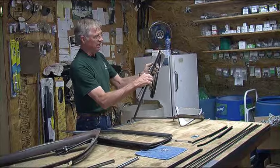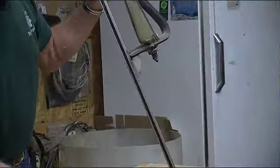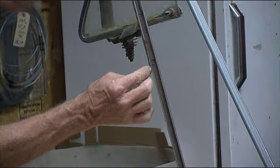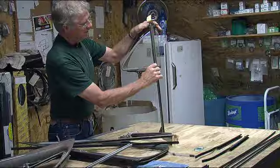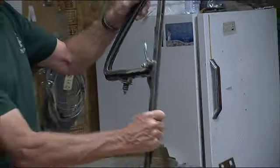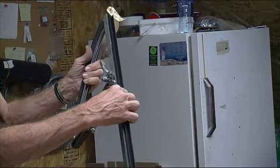If you don't have round beading on the channel, that's a '50. Notice the round beading that's on the '51 actual channel — it's part of the channel, rounded here. So if you don't know if you have a '50 or '51, you don't even have to take your car apart. Just look at the car. If you've got that round beading, that's a '51. If you don't have that round beading, you have a '50, because this channel doesn't need it — it just lays in there.